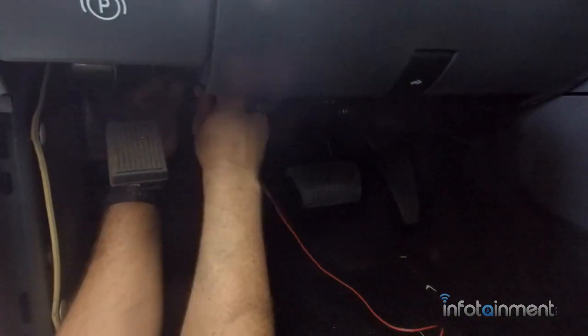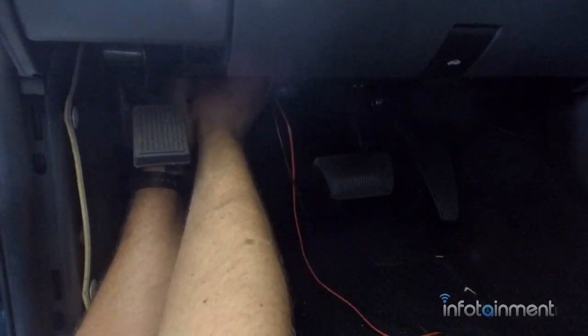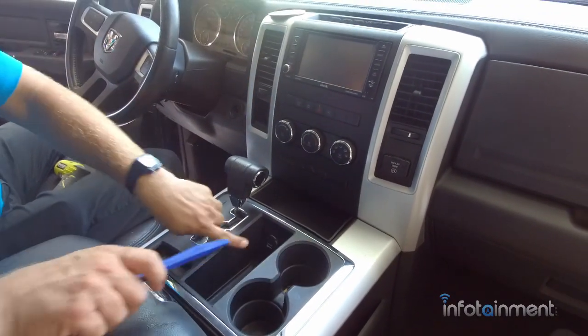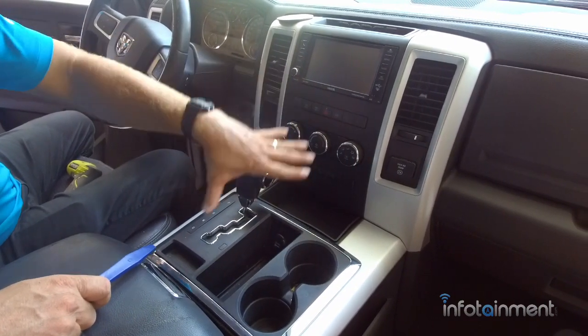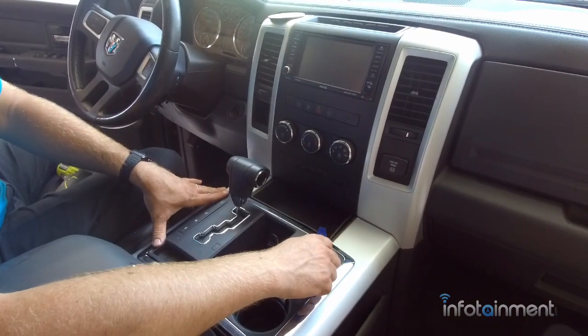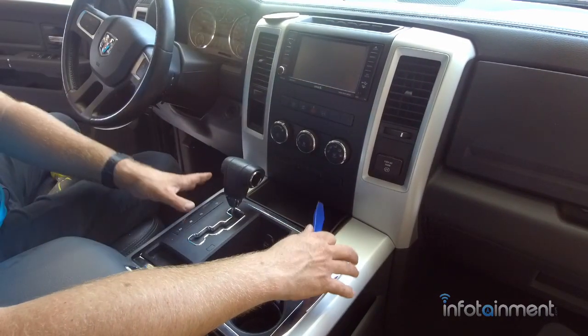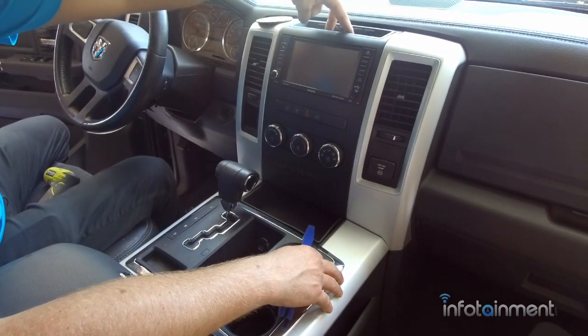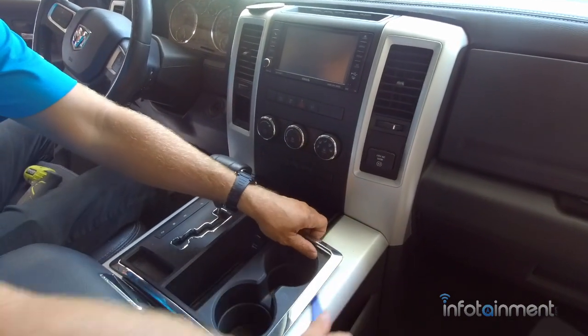Now what we can do is start making our way over to the radio. We obviously want to keep the wiring away from the gas pedal and the brake pedal. In order to interface the wiring with the cigarette lighter and the video with the radio, we need to take this apart. This particular vehicle has a center console, so we're going to take this apart. There are two screws up here and then a screw behind here. If your vehicle does not have a center console, not to worry — you're only going to have three screws: two above the radio and one right behind this little panel here. Let's go ahead and pop this little trim off.